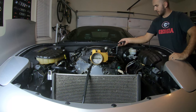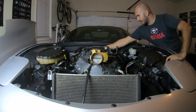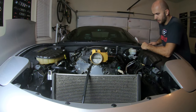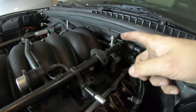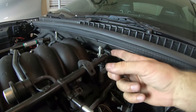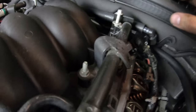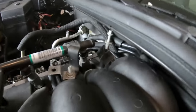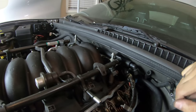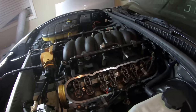Now I'm just going to run these two behind here, connect them to the vacuum line and the connector to the back, and drop the whole intake manifold in place. The two rear bolts you can now remove because they are going to be sliding underneath here, but you don't want them at the bottom either. So what I did is I took some tape and taped them slightly up until I push them in there — then just remove the tape and they should slide in there perfectly. The intake manifold has slid back into place.